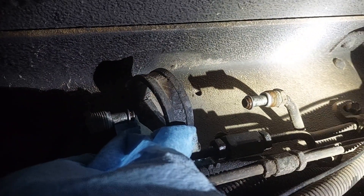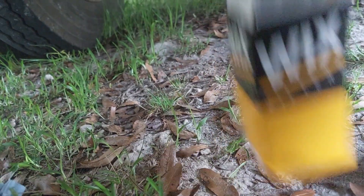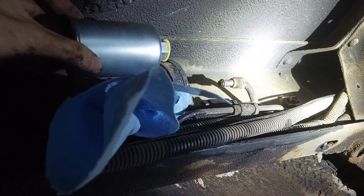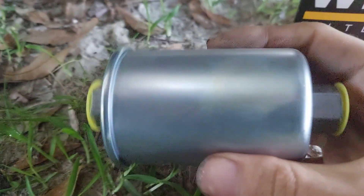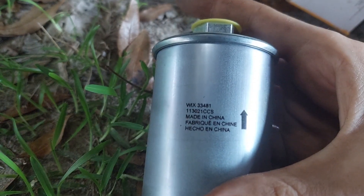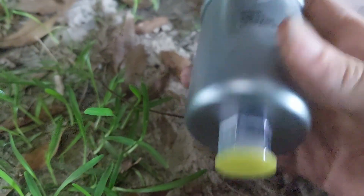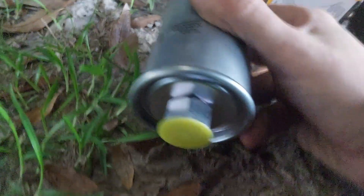So what we shall do is slide this in through the back. We are going to look for any kind of an arrow that tells us there is directionality on this thing. This has got a lip on it. We are going to look for an arrow or something like that. Here we go — I am going to guess that is towards the engine. That would line up with what I am thinking, but at least they could write 'to engine' or something like that. We are going to insert it like this — this being the front facing the engine, this being the back facing the tank. Let's go ahead and get this in.